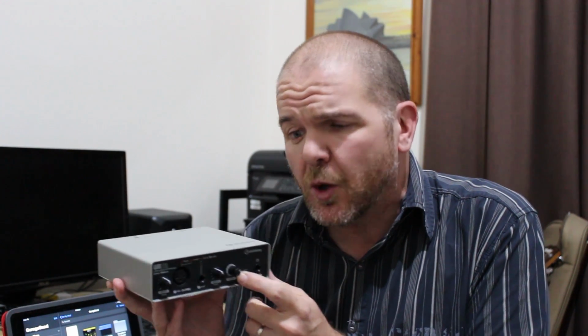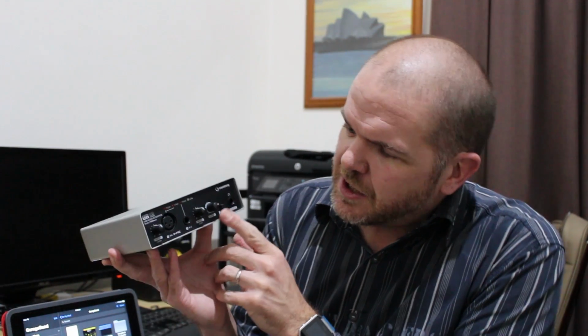We've got direct monitoring. So if we want 100% latency-free monitoring, and that's probably something I haven't mentioned with the others, because you're monitoring through the software and through the headphones coming back out of your actual iOS device, then there can be some lag or latency. And if you're recording an epic guitar solo, the last thing you want is for a whole bunch of lag, which is going to mean that you're not going to be able to play in time with the tracks you've already recorded. So this is a solution for that.